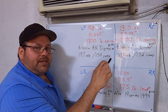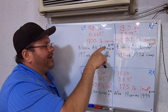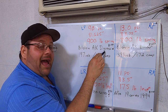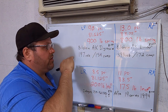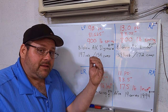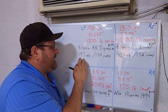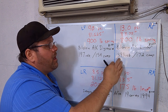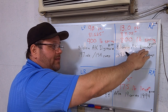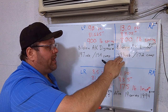On the front shocks, I've been really happy with Bilstein stock shocks — non-rebuildable, about $100 each. The left front is a Bilstein AK — it's digressive. Think of a curve: flat, curved upward, or curved downward in relationship to shock speed versus resistance strength — that's what digressive, linear, and progressive refer to. This left front is 197 rebound, 154 compression. On the right front, I'm running the same Bilstein AK series but linear — 393 rebound, 172 compression. These AK series shocks are actually purposed for metric cars, and I'm running them on my Camaro.